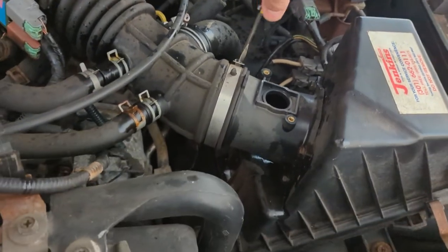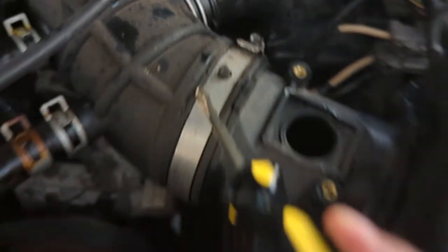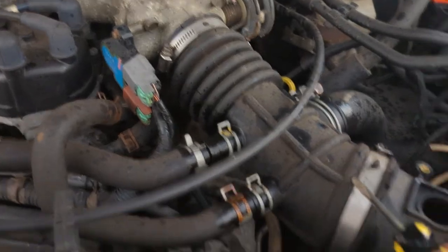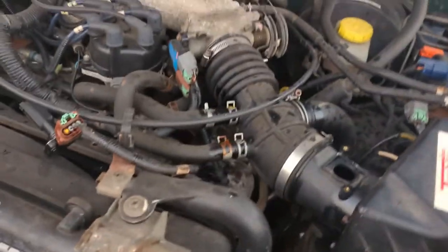So we're taking out our hose clamp over here. These are all the vacuum lines over here that look to be in decent shape, honestly. Because if you were in here and these were cracked, you might want to get them changed. You can tell over here this is all cracked — like all that. This is going to cause vacuum leaks and the car's not going to run right. I'm surprised how well it runs considering, because this cracks all up in this. This is your main intake hose right here — that's not very good.